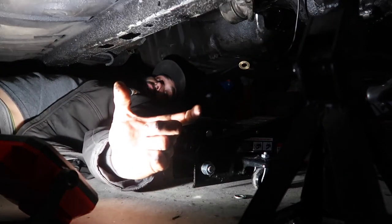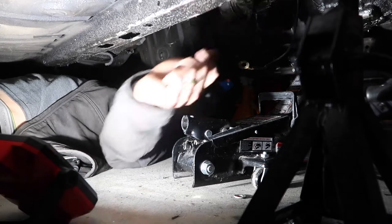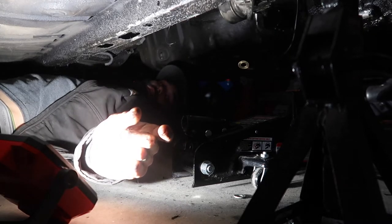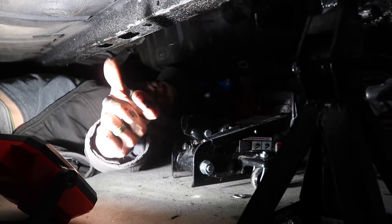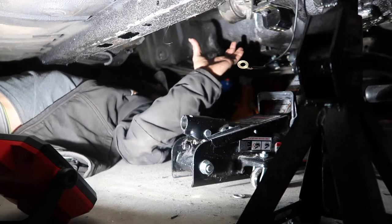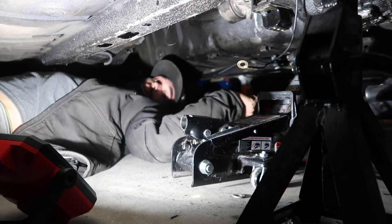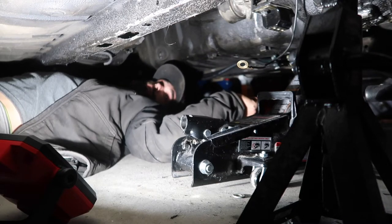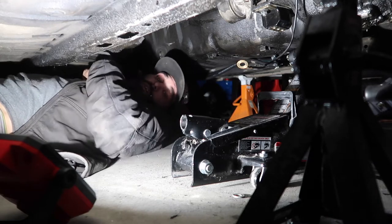of the yoke, and he will make it to where the yoke is basically input all the way in with 3/4 to an inch of play, and be able to give us a little bit of slip in there for when we go to slide that thing all the way in, we've got enough clearance to actually install the driveline and then slip it back onto the rear face of the flange of the rear differential. So 35 3/4 inches is the measurement, if you want to write that down.